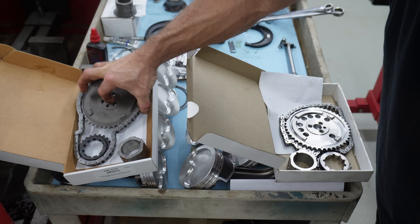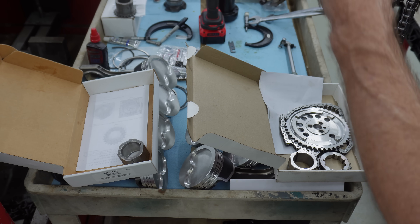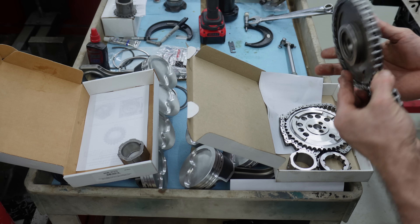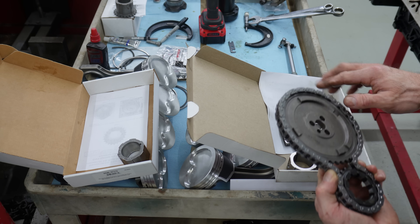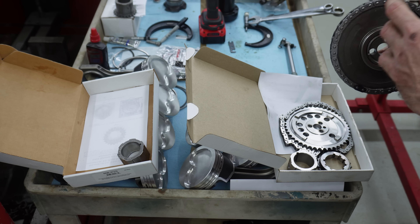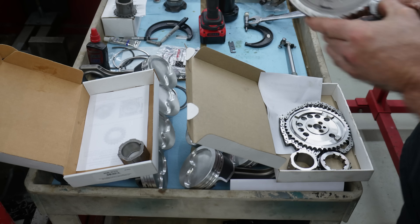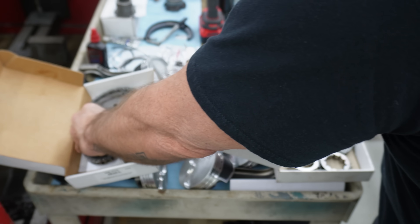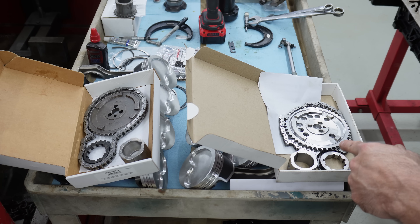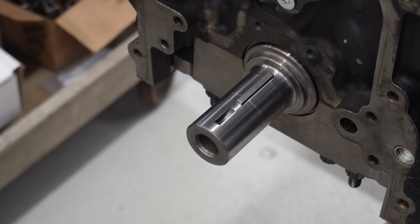The SA Gear just seems to roll better. The chains are very similar but definitely not the same chain - the way the link pinning is on the two is different. I've had tons of these in pretty high horsepower LS stuff that's come in for freshening and they're still nice and tight after being run. These are manufactured in the USA, and the SA Gear is about $25 or $30 cheaper than the Rollmaster.